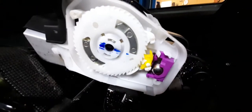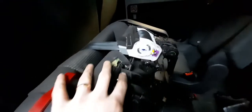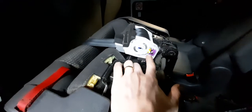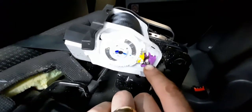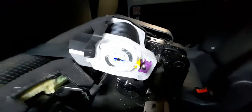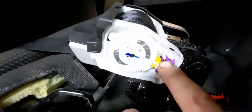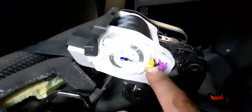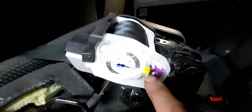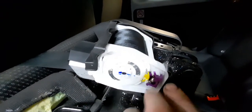As you can see, it's nice and locked in because the seat is in this orientation. When the seat's in this orientation it will always be locked and the seat belt won't move, because this ball is affected by inertia and gravity — it moves around and it's supposed to. You see this purple tab here? This tab pushes up on the yellow part, which allows it to engage.